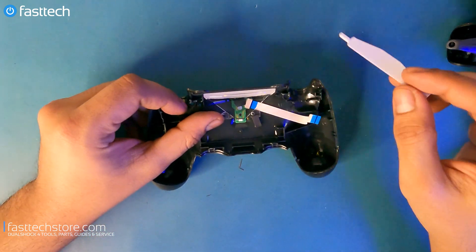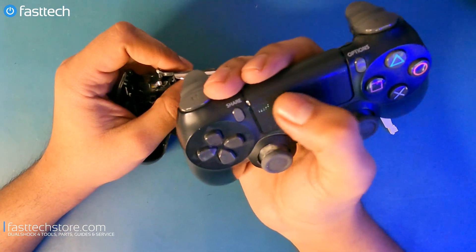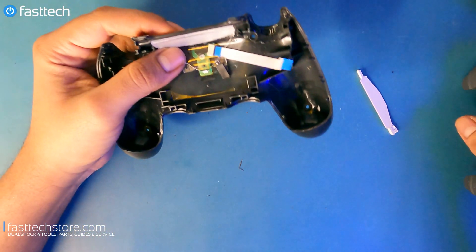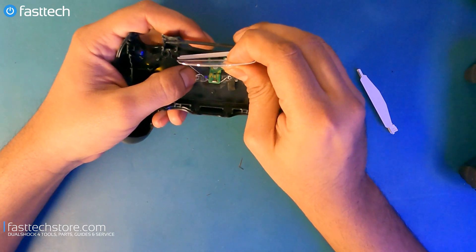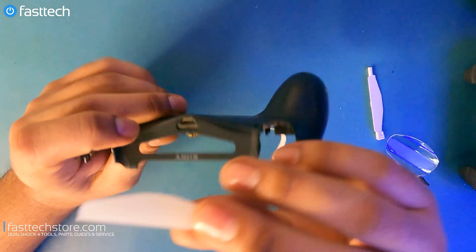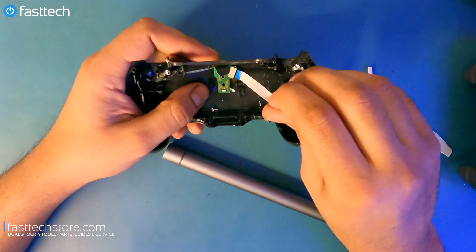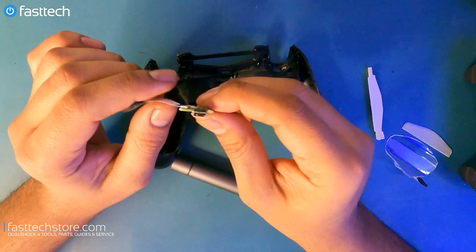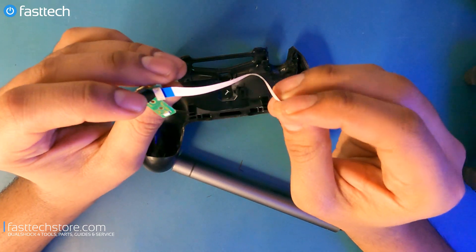All you've got to do is lift this piece up. Get this plastic piece out — it reflects light to the front. The newer models have a light bar in the front, and this is the piece that reflects light from the back all the way to the front. It slots in here. We're going to lift up this piece — there's a plastic little tooth it sits under. Lift it out, and the light bar is going to drop out. There's a Phillips screw holding this piece in — remove it, then lift up the USB charging port. There's tape that also holds it in. That's the USB charging port that breaks quite frequently, but luckily it's modular, so it can be easily replaced.